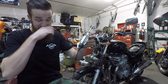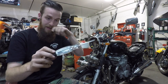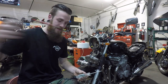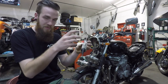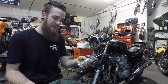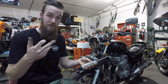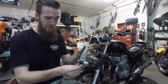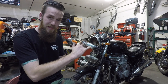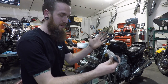This is the one that I use — a high-end Snap-on, about 60 bucks. It works just like the basic one: simple light and fuse. But it also has a little mini computer inside that registers voltage — it tells me the volt rating, and it has two lights: a green light means it's grounded, a red light means it's a hot wire. When it's a hot wire you actually get a digital readout of the voltage. All it does is complete a connection and give you a reading.